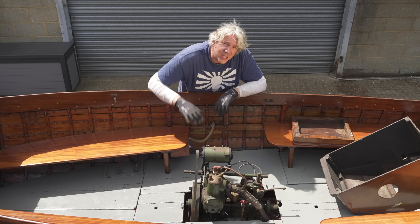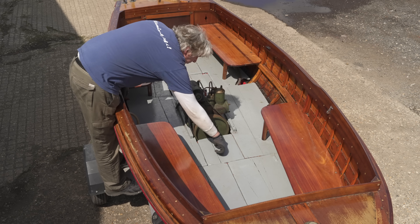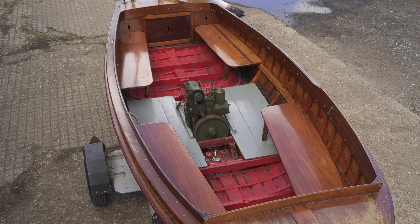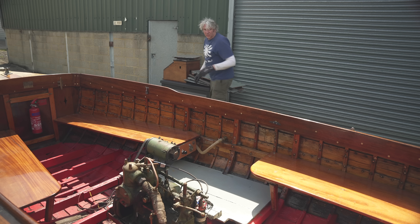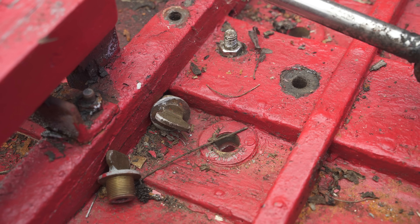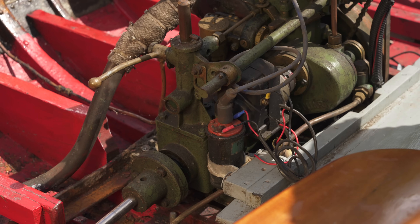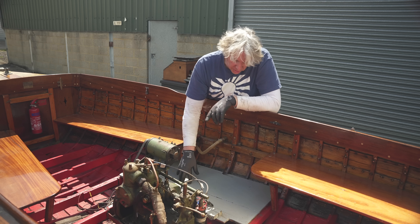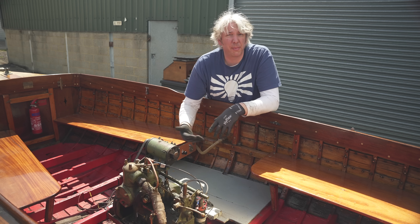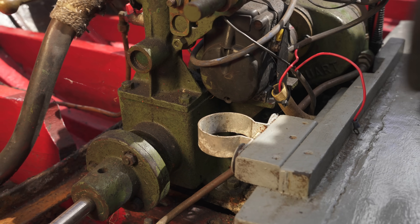The question is, will it actually work? I'm going to take a bit more of the floor away so I can see everything that's going on. We're down to the last piece of flooring and you can see we've already revealed a few nasties, including two drain plug holes that haven't actually been done up. So that would have definitely scuppered us when we tried to get into the river. On this last piece of flooring, you can see there's a coil that's been screwed into the wood. On this model of motor, back in the early days it would have had a magneto for ignition and then later on it would have moved over to having a coil and points. This doesn't actually look very stock, so somebody's gone for some reliability or maybe just replaced parts they couldn't get hold of. Either way, we need to remove that before I can take out the last bit of flooring.